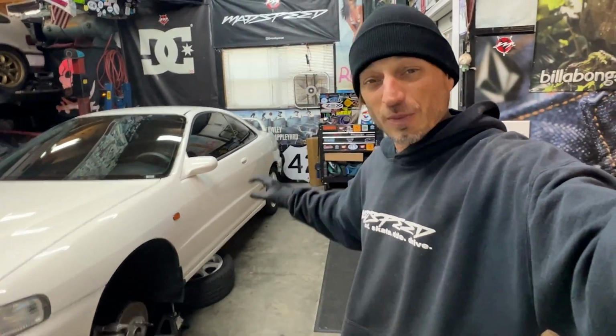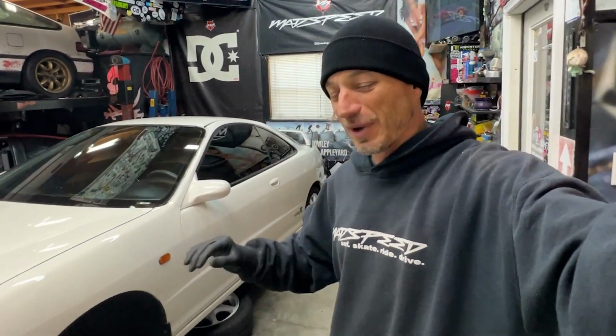So we kind of took a guess and we did about 5 turns down on those coilovers. We're just going to measure now and see where that puts us. Best thing to do for us is just pretty much drive it around the block, let the car sort of settle, and then take the measurements. And we want to match where the back was already sitting because it was sitting pretty much how we want it to be. So we want to match the front to the back. Here we go.